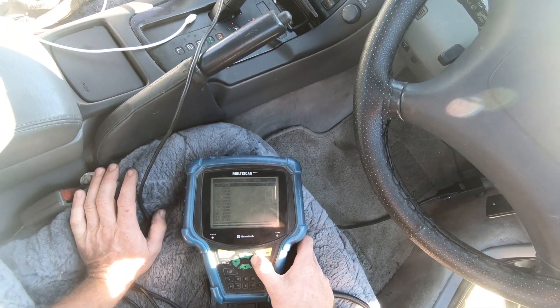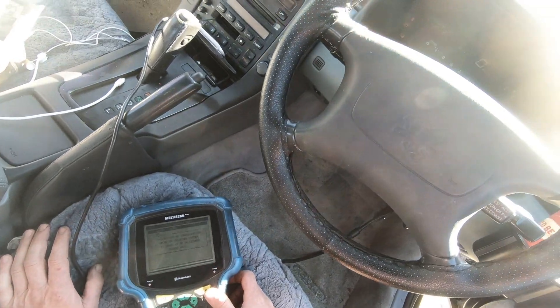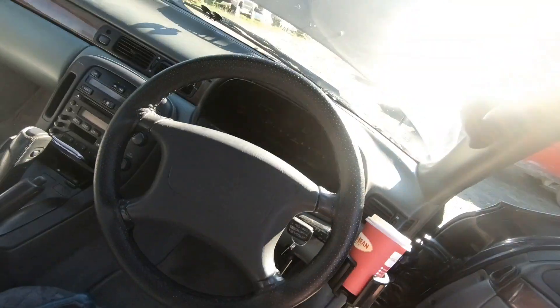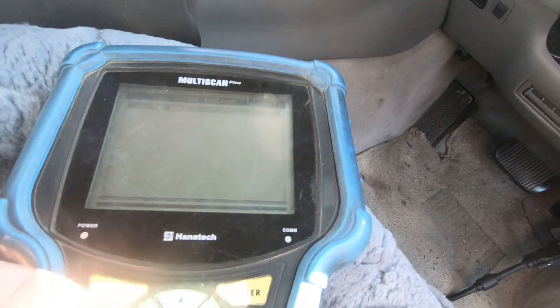I'm going to go in as 'other' — it's a semi-circle connector — we're going to engine control. As you might have noticed, this is a topic that really annoys me, and after many years most mechanics should know how to use these properly. Here it is counting flashes — you can see those pulses. It's pulsing because this one goes through the digital dash. It's checking trouble codes and it's actually got a code: throttle position sensor, code 41.